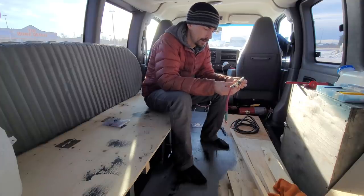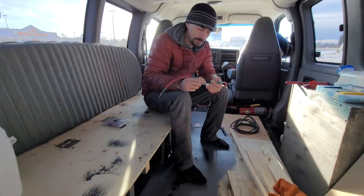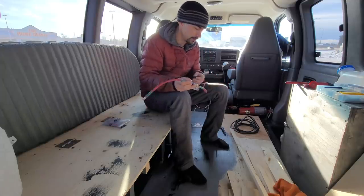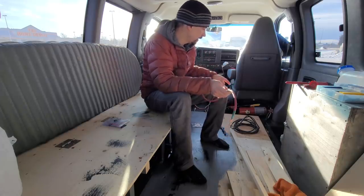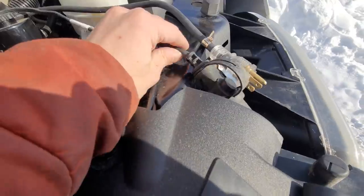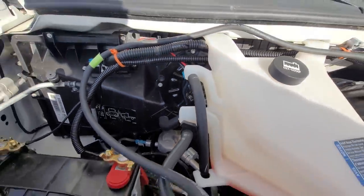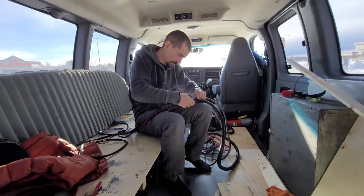My workspace is becoming such a mess. I've decided today is going to be an electrical day - I'm going to route the wiring for the DC to DC charger. I've got the 60-amp model so I'm going with four-gauge wire; it asks for a 90-amp fuse but I could only find a 100-amp. I've already got started by getting myself dirty and wiring up the fuse - this is going to be right up against the battery. I also want to run an extension cord along here so I can run shore power when I need to, and I'm going to drill a hole in the step where it'll all come out. Then I'll route it down towards the back from there. Now for the fun part - split loom.